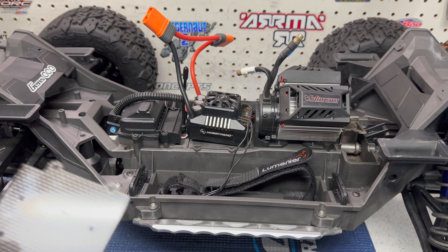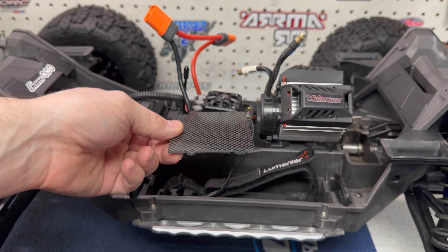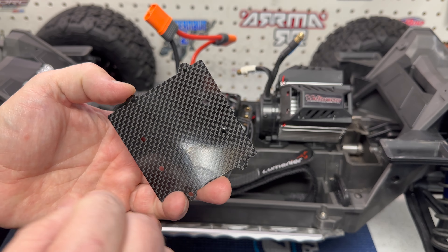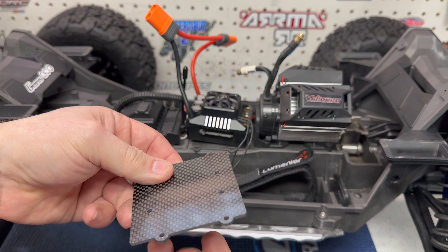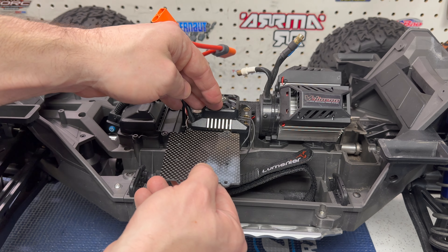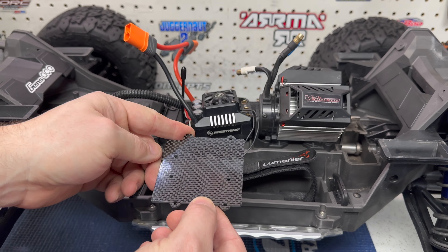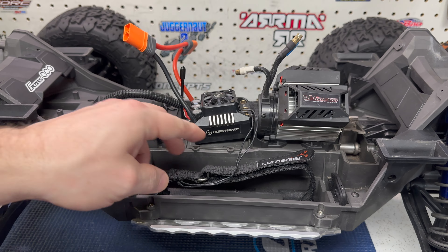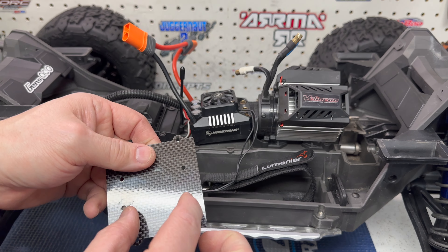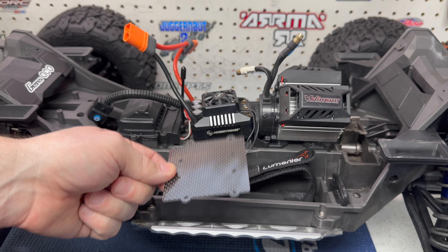Before continuing with the install, let me show you what I'm doing. This is the actual plate that sits on the chassis. You've got these four holes right here, and with the included hardware you get four cap screws. Those four cap screws go through and screw into the bottom of the Max 6, because there are threaded holes at the bottom of the Max 6. You're then able to screw this plate down to the chassis, so instead of velcro or an ugly zip tie, the ESC is mounted to a plate which is then mounted to the chassis itself.